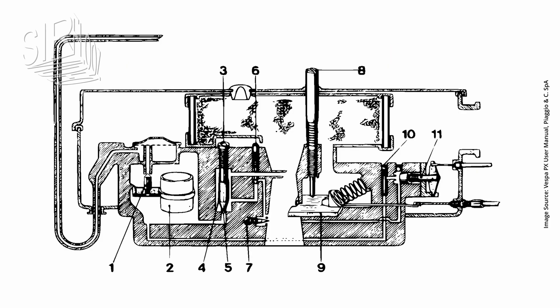Here is a schematic diagram. When the fuel tap is open, the fuel flows into the carburetor through the fuel filter and through the open valve. This fills the reservoir around the float until a level is reached that is sufficient to supply all the jets. The float needle, raised by the float, then reduces or stops the fuel flow to maintain this fluid level. The jets then form the required mixture of fuel and air.